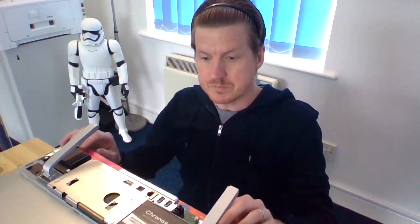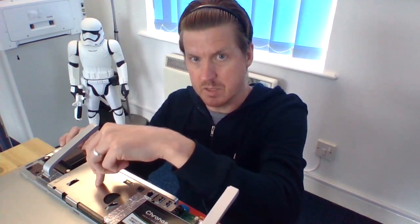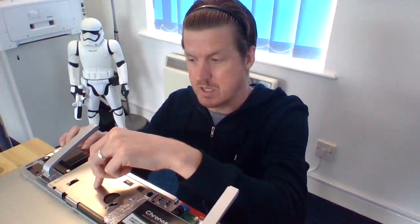So if you're upgrading your hard drive, that's right here. In mine I've already done an SSD upgrade, but if you wanted to do that, there are just a couple of screws here and here to loosen up — take out your hard drive and do whatever you want to do with that. If you are upgrading the RAM, it's under this panel here. There's only a single slot there, as I mentioned earlier in the video.